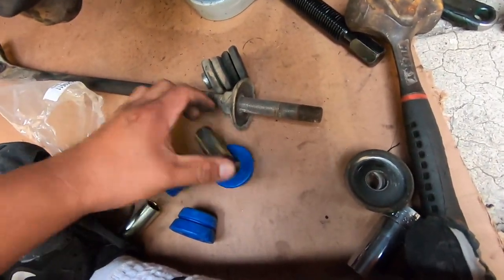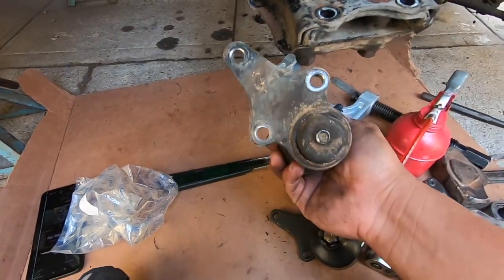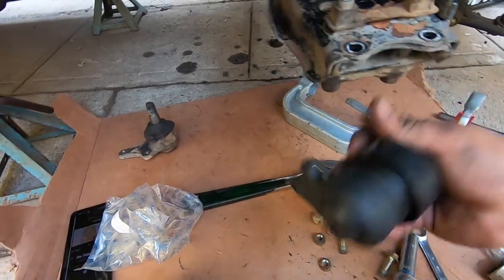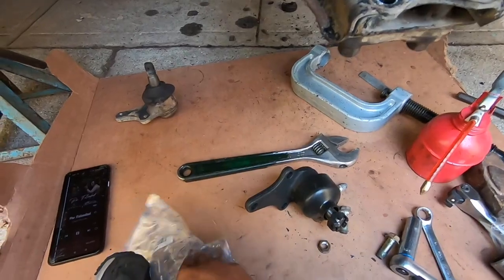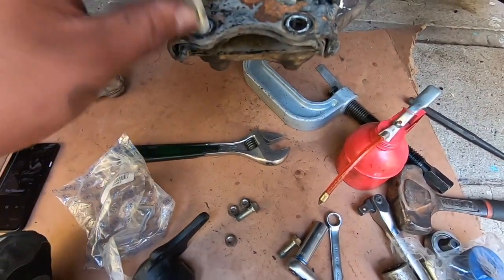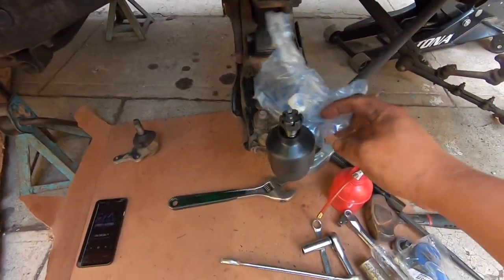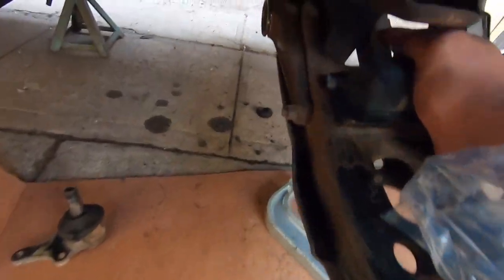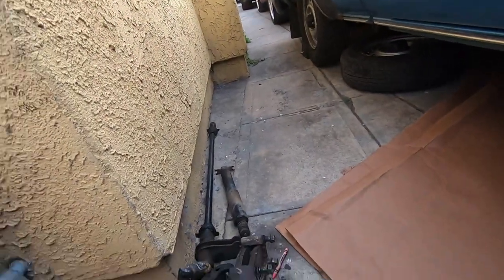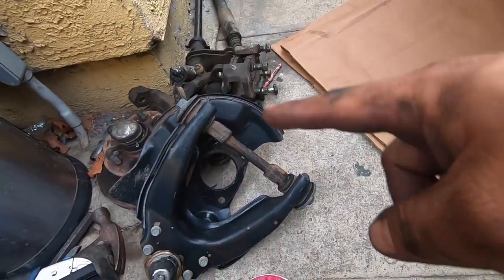We removed the ball joint — the old one is actually pretty stiff still but we're gonna replace it. It looks pretty old. The new one we're gonna install — putting in the cotter pins and grease fitting. We'll have to reuse these old bolts since it didn't come with new bolts. We got the ball joint in, the new bushing is in the back. We marked the torsion key so the bar goes in aligned. Then we'll start with the upper control arm bushings — looks like it's gonna be a hassle.